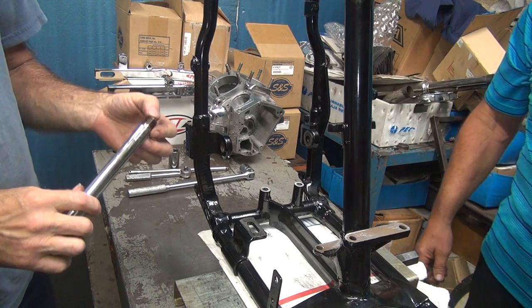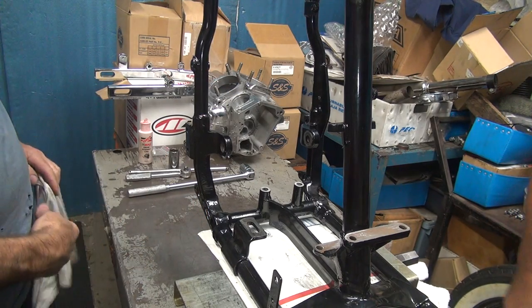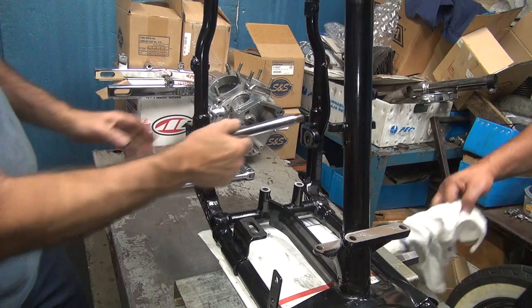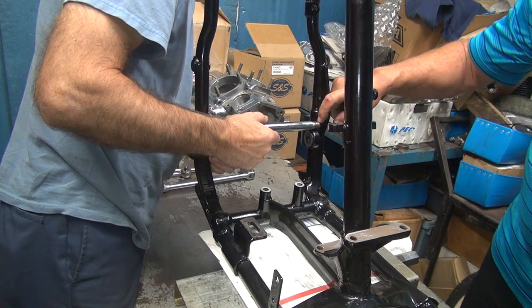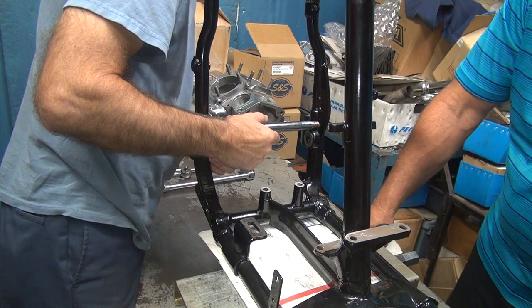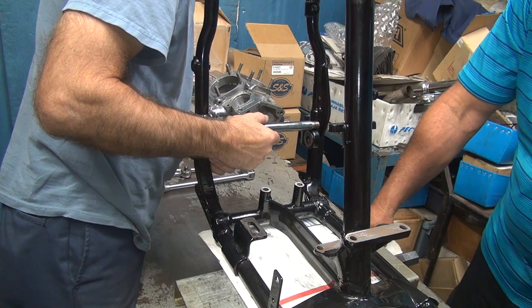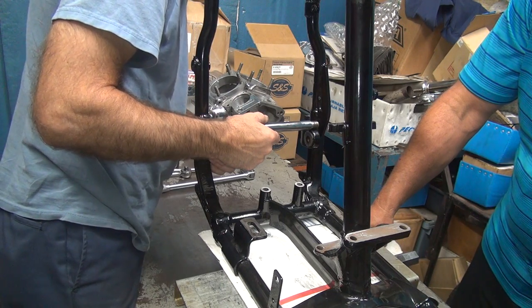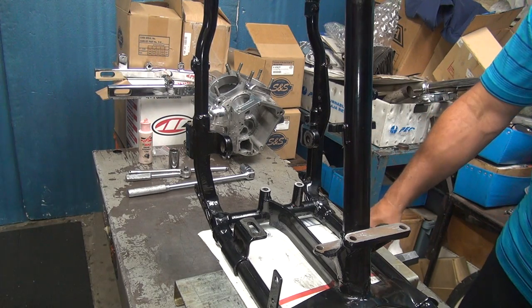That looks a lot better now. So I'm going to take this over the lathe. I'm going to cut this shoulder back about 100 thou. How much will that stick through when we're in that deep? It'll stick through about 3 or 4 threads when you're done. That would look way long, wouldn't it? I wonder if it's going to interfere with anything. Probably not. No, there's nothing here. Alright, go cut that.